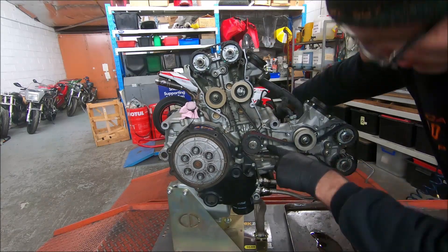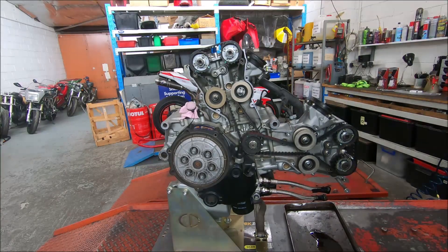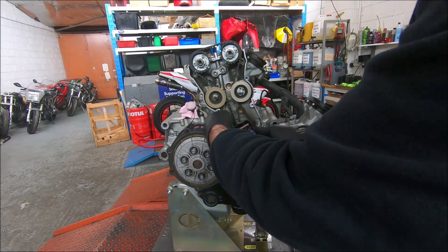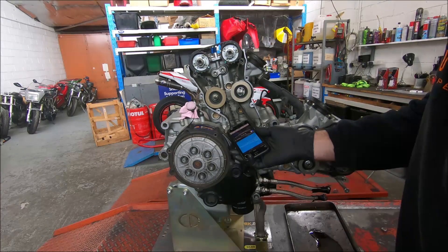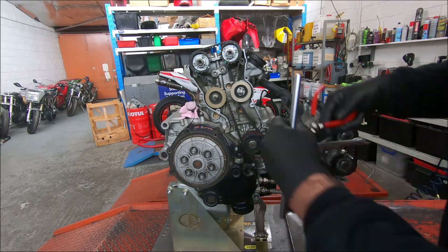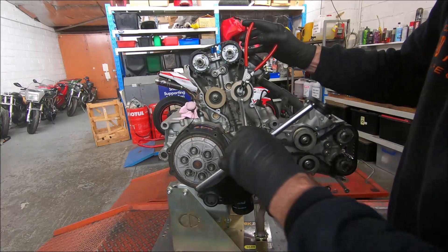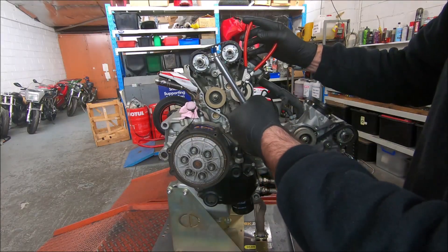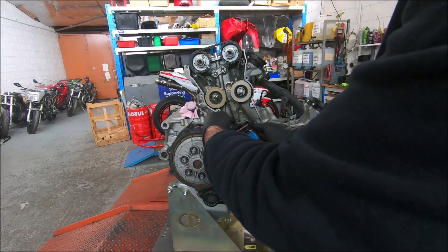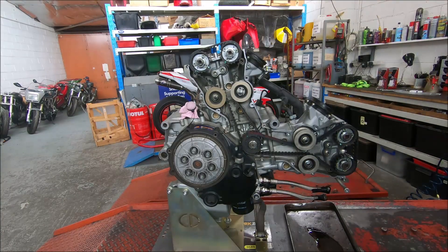Turn it over until we get the dot to about three o'clock here, which is vertical top dead centre firing, and then we'll check the vertical belt. It's 90, so I'll put a little bit more on the vertical. 93 — but always turn it over once you've done that.